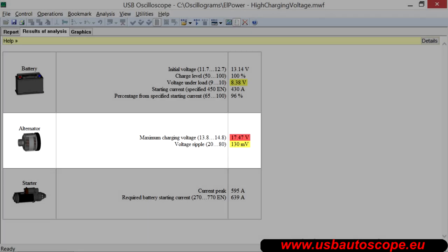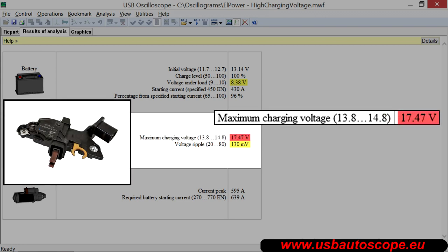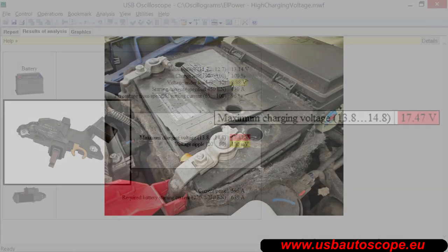In the following example, on the contrary, the voltage regulator is setting a very high charging voltage from the alternator — 17.5 volts. That is undesirable for vehicle electronics as well as the battery. Moreover, high charging voltage may cause intensive electrolysis of water in the electrolyte and the rapid formation of gas. This gas is an explosive mixture of hydrogen and oxygen. An electric spark, the flame of a lighter, or an incandescent material can cause an explosion of a force sufficient to destroy the battery housing.